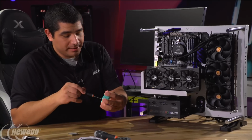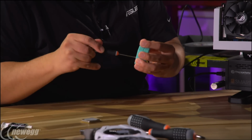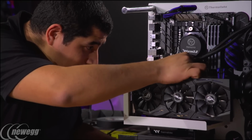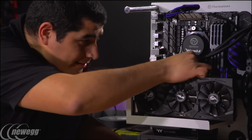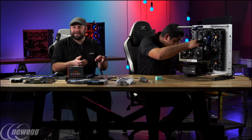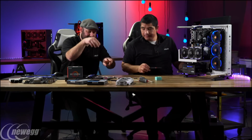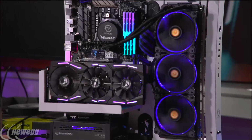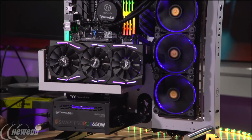All right, so let me go ahead and jump our lead here, guys. Give me one moment. Okay, and I can get this. With a graphics card like that, it's a little tougher to jump it. So basically what he's doing is there are pins that you connect the power switch to. And if you connect those two pins with a screwdriver, it connects the circuit, so it turns on. Yep. And it worked. I wouldn't suggest trying that at home unless you're like a pro, because you could probably cause some damage.